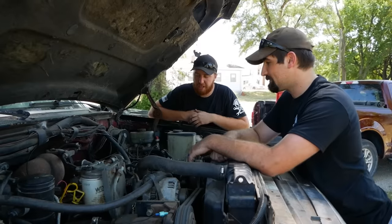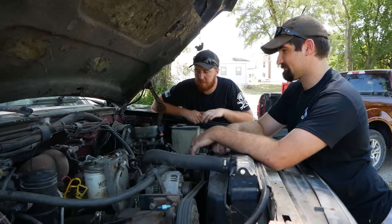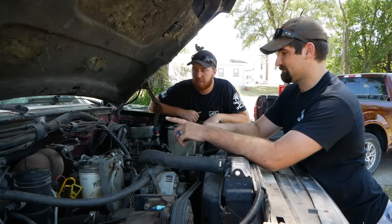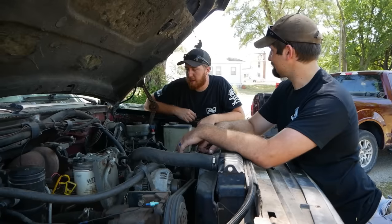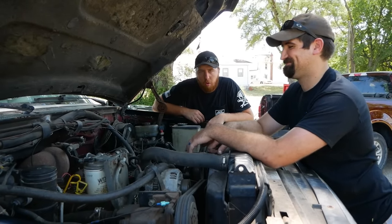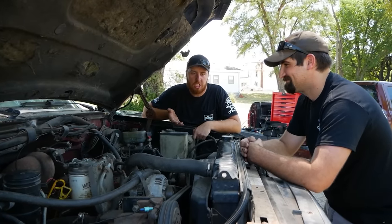There was a lot of blow-by, and I didn't realize it till afterwards. Had this been a gas, I would have been like, oh, all the gases are slipping past the rings and there's no compression. I don't know why it never dawned on me that day. I'm like, wow, that's a lot of smoke coming out of the bottom of the motor. That's weird. Wonder where that's coming from. Definitely not from around the rings, Kevin, you idiot.